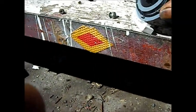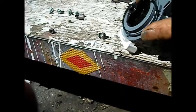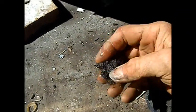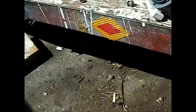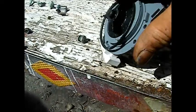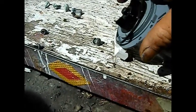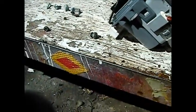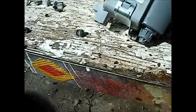I don't know how you can make a filter that doesn't let hair past it. But this pump is actually still good - it has withstood this. It's a pretty tight bundle of hair that was stuck right in that port. If you go like this and you don't feel that magnet, then the impeller has become disconnected from the motor shaft. This one's still good.